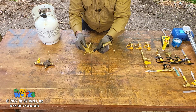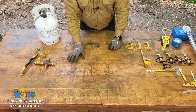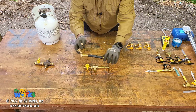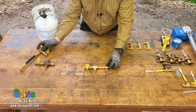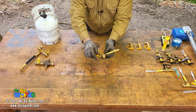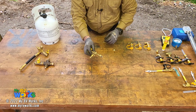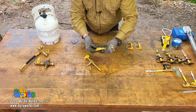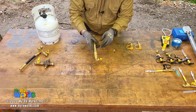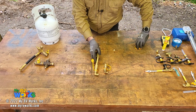And I used this for a number of years. Then I would be working on these systems, and I would need to tap into different parts. So then I took this design and I basically decided, well, I don't need it to be flexible anymore. That didn't need that. And I basically created this one here. So here's my number 41 hole. I had a gas valve, manometer would connect to here, and I made this kind of like a quick connect. And so, for example, I would have had there. So now I have, that's actually a 1/2 inch, and I made a 3/8. Okay, so I made a 3/8 and a 1/2 inch.